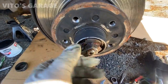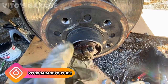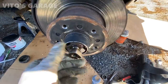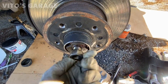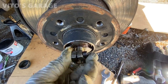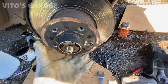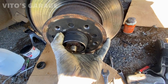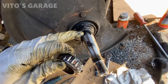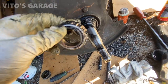I'm loosening this six millimeter Allen and taking the nut out, then removing the whole hub assembly. Be very clean with the bearings — that's really important — and don't damage the spindle threads. Clean the area, then grab the assembly and slide the whole thing out carefully. Now I'll clean these bearings and re-grease them. The bearing was stuck on the spindle and I had to work at it with some tools. Got new wheel seals to take care of all this.